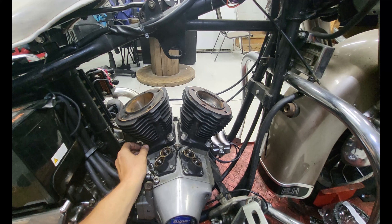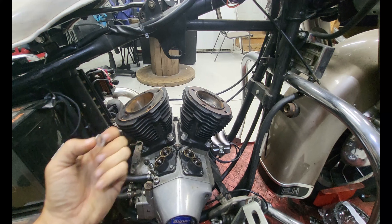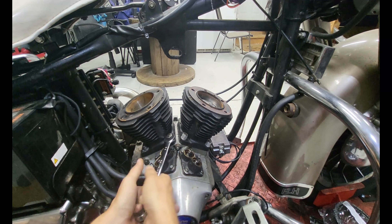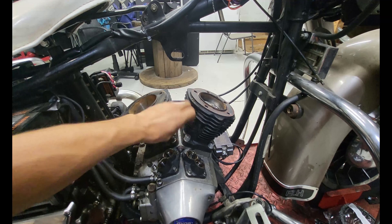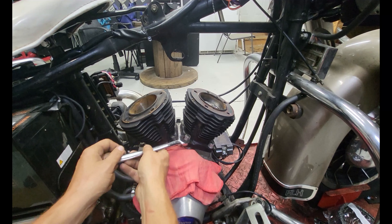Yours might not come off this easy - these were torqued years ago but they didn't have any run time on them, so I'm guessing that's helping. One of my videos was solid lifter adjustments, but this one has hydraulic lifters so we get to go over that adjustment - that'll be fun. These lock washers are something we're going to replace. They aren't necessarily wear items, but once you squeeze them down they stay a little crushed, and we don't want that. I'm going to do something just to keep crap off of the lifters here.